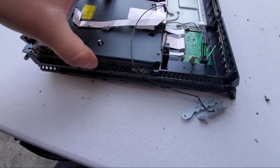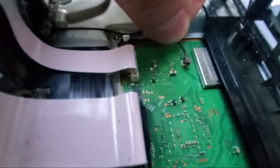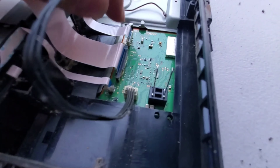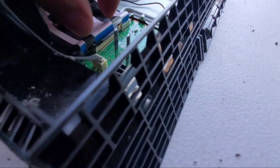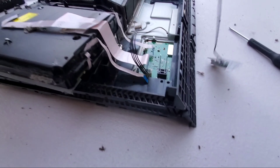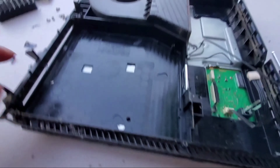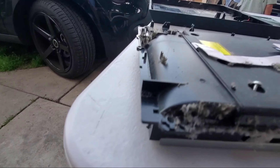Okay, so now I'm gonna remove this guy. By removing that we have to unplug it from here — this little cable, it's just right there. This guy was just there so I just pulled it up and it came out. Now we have these three little things here — one, two, three — and this black thing, just pull it up a little bit from both sides. That's gonna give you access to remove this blue tape here. Once you unplug them, just carefully, then you can remove this guy. Put that guy there, and we have this piece here. A screw came out — I don't wanna miss that screw that goes there. Let's put that guy there, and it leaves us here. So we can clean up — this is not that dirty actually, but this guy is dirty on the sides and the top, so we're gonna clean that guy out.